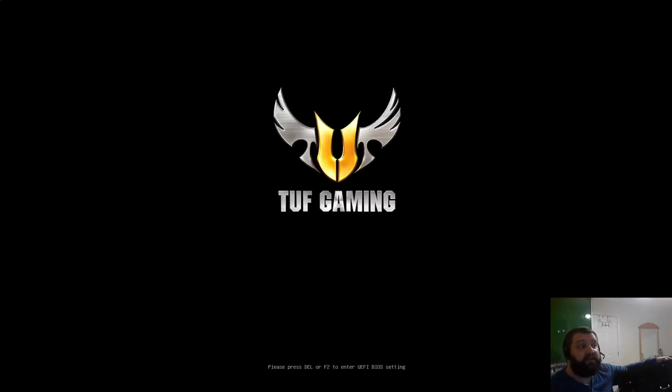It's in there, and I accidentally pressed the power button with my hand. Thankfully, the memory was in, and it booted up. So I removed the memory module a few times, plugged it back in, didn't reset the BIOS, and then it comes back. So it's obviously working erratically. So let's see. And it froze. Let's try resetting it.